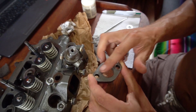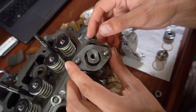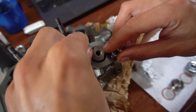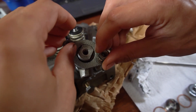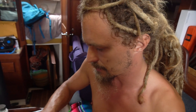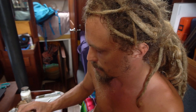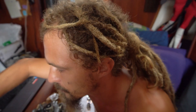The dimples go downward, the flat side up. Just slap this guy on and it should put pressure down to hold everything in place. I didn't really want to put the injectors on right away because they might get in my way when I put the head on, but since those things aren't staying in the right spot, I can always move them once the head is on. This way I won't accidentally end up with these little gaskets moving around while I'm moving the head around. So we'll leave this till the end, and I'll just have to push the gasket up once the head's on.